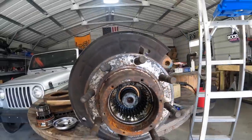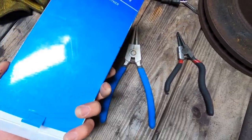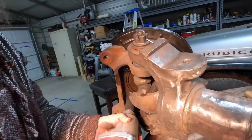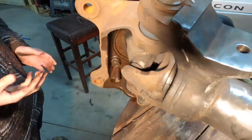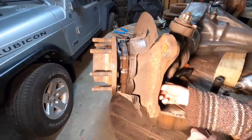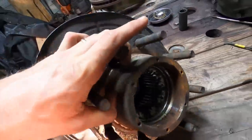Next is this snap ring. We used 9-inch external snap ring pliers — solid spring removal tool. They're a little bit bigger than the snap ring pliers we had, but that's just the little bit we needed. Next thing we're going to do is undo the four unit bearing bolts on the back of the unit bearing. Take one of the nuts and put it back on a stud — just screw it down until it's flush with the end of the stud. That nut has a flange on it, so the socket can't go over it. When we smack it with the hammer, it'll come right out. Now you can remove the unit bearing. The hub looks good — everything looks nice in here, a little greasy. We'll clean all this up.